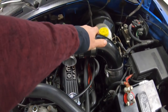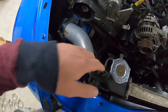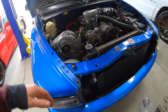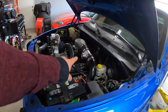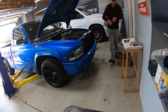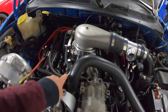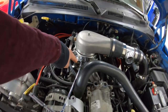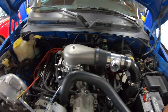Everything over here is super solid and tight — just need to put the blow-off valve on. I'm tight all the way around on that side; over here I'm tightening up all the remaining clamps and adding one more band clamp. I tightened the fitting we have on there, and over here we have a brass barb that I'm going to replace with a push-to-connect fitting. Before, the brass barb with a rubber hose went around to the ProCharger bypass valve; now it'll go from here to the throttle body — a shorter, more direct path.